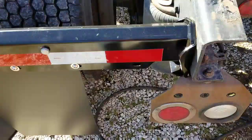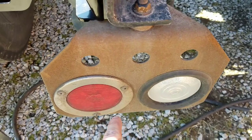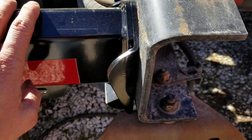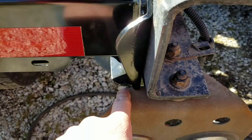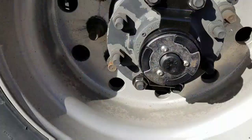The first thing — if you can see right here — this is the turn signal assembly for the back of the truck. There are a couple of spacer plates in my old one that are right here against the frame, and they held it out just a half inch or so. What I ended up having to do is just cut a tiny little notch out of the turn signal.